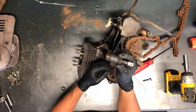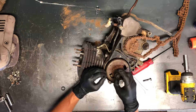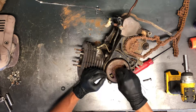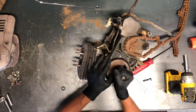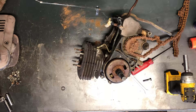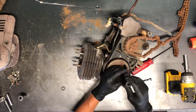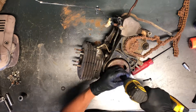This is what the flywheel puller looks like — this is for a different bike on this side, but this larger side here is what we'll use. You run this in reverse thread, so you spin it counterclockwise for removal, and you want to tighten it up completely. If it's not tightened up completely, there's a pretty good chance you'll pull those threads right out of there. Take a socket on the end — this part is regular thread — and spin that down.